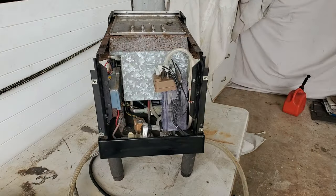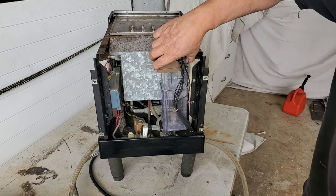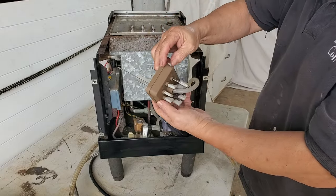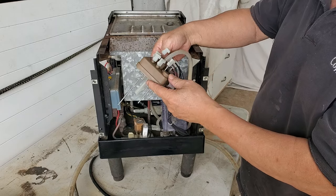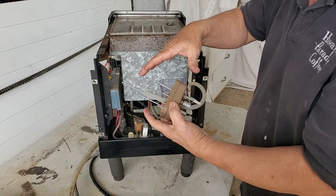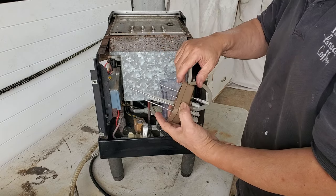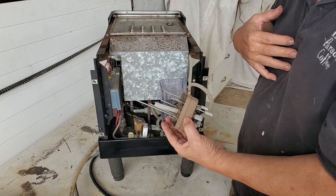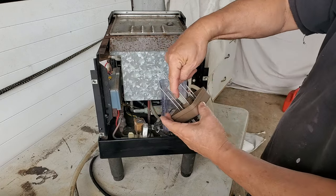Here's the back plate off. This is the dosing tank - it just clips on. There was a question asked: how do you set these probes? If you wanted to, you could just flatten everything down - it's pretty much preset. This one is set up for my particular type of coffees, but generally speaking it will be like a staircase going up.